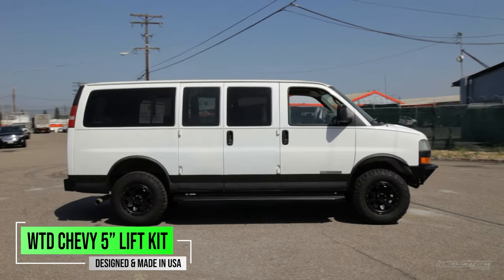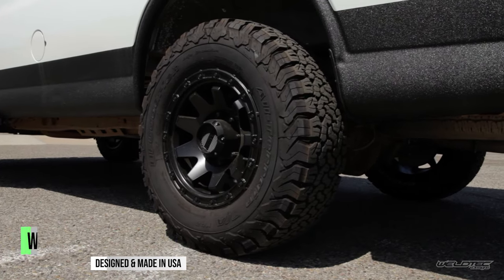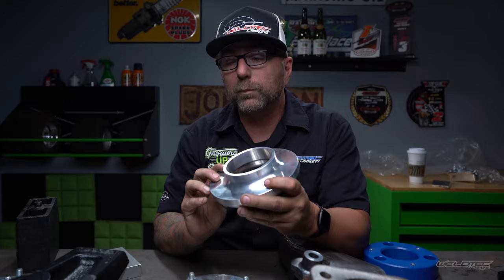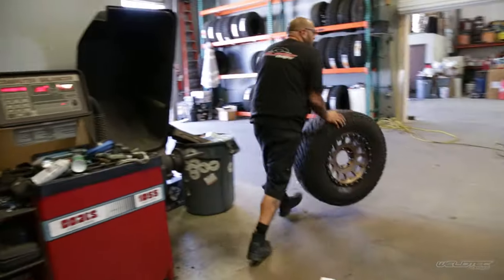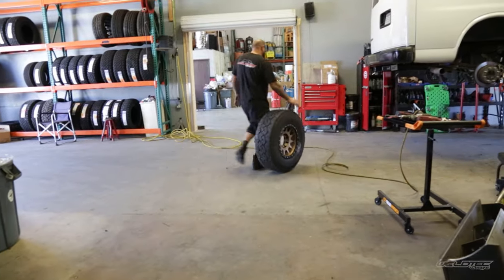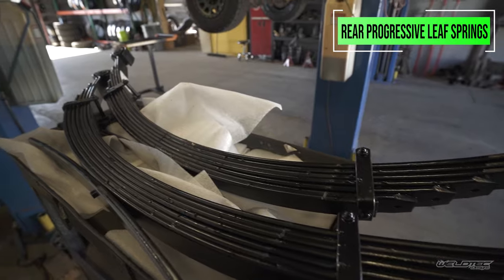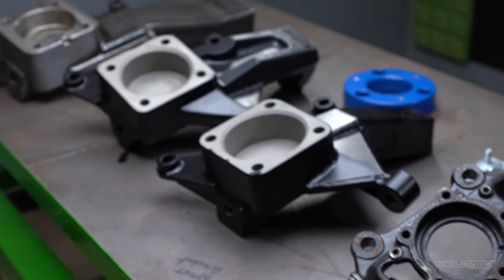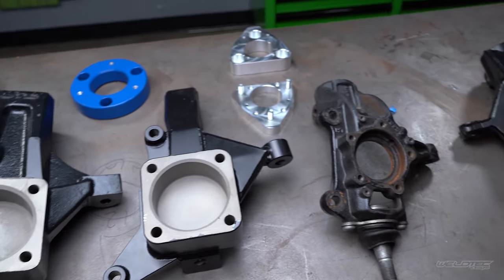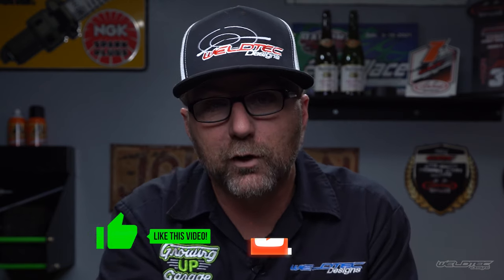The benefit of that is you're able to run an even larger tire. For example, on the Chevy Express kit, when you take the two-inch spacer and the three-inch spindle, you can run a 285/70R17. You can also add progressive leaf springs to the rear, giving you a really nice ride. There are definitely advantages of both and how they can work together. I hope that clears up the difference between a coil spacer lift and a spindle lift. See you guys in class next time — I'm Professor Jeremy.